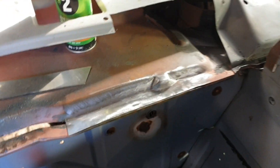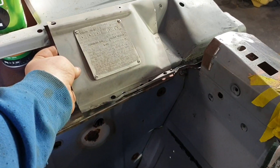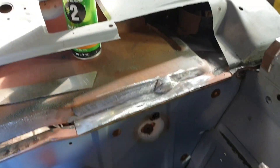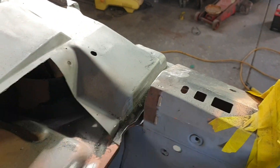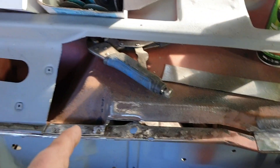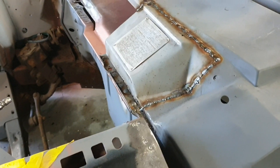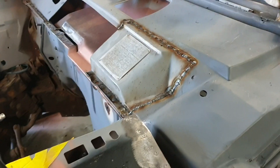I'm going to put the ID tag and piece of plenum back in - it came out of there so it should go back in. Put that back in and then do this piece here and put that one back on as well. That way this whole side's finished up and then we can just focus on the middle. There we go - the new piece is in, welded up. Just got to wire wheel it, clean it, grind it, and then I can put the next piece in.